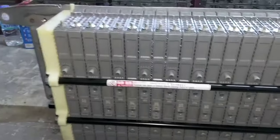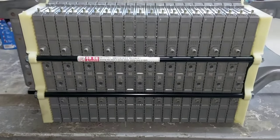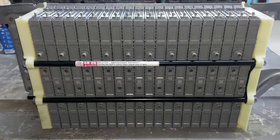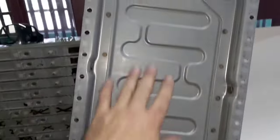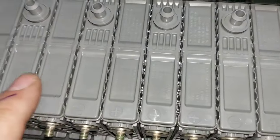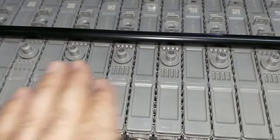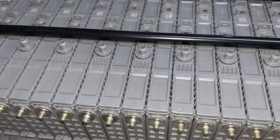Now I'm going to explain how and why you service this battery, and how often. Some of you may be familiar with the Dr. Prius application. The battery management unit monitors voltage not of individual modules but in pairs of blocks. If we have 20 individual modules connected in series, I monitor them in pairs. In normal operation, the cells should be balanced — charging and discharging equally.